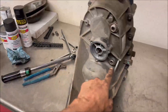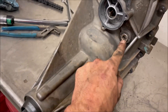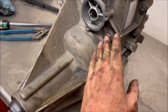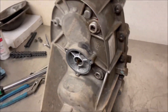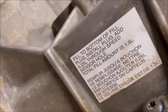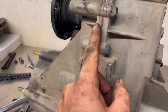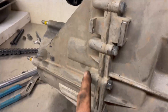This one is from an 06, and the telltale is the fill plug — this is in the wrong place. This plug was relocated up higher for 2008. So your 2006 and 2007, you cannot get enough fluid in here. In fact, they even put a label on here about it. And in here you can see the original factory squeeze-out and how minimal there is — this is the proper amount of sealant you should be going for.